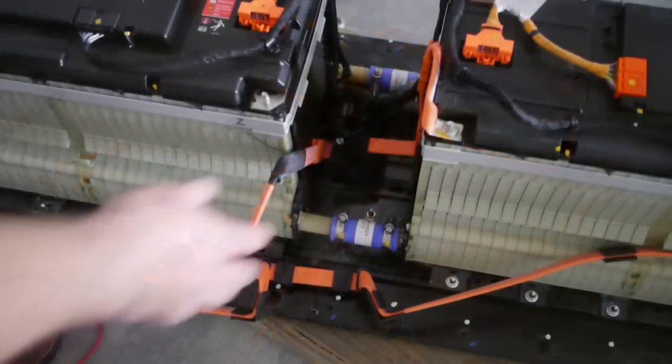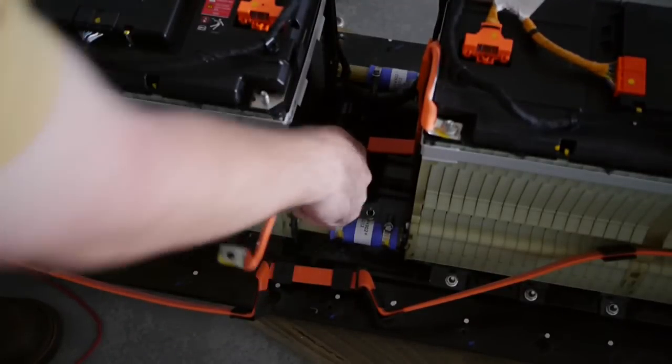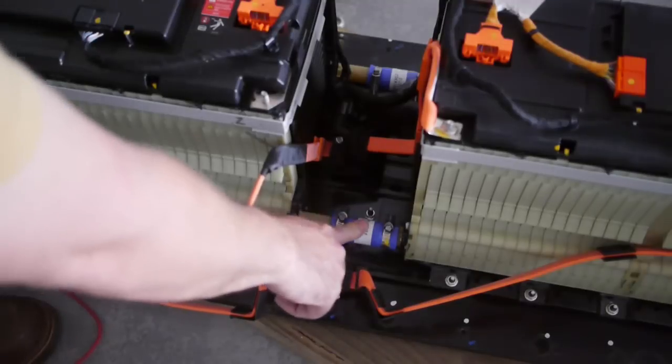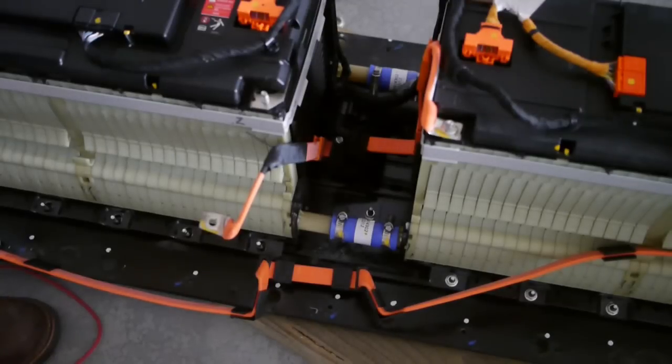One note here — just taking off the battery cables, they pass through this, which I believe is probably a Hall effect current sensor. I'll have to pull that open to see. It gives you a better shot of the coolant lines. Obviously they kept it flexible so that they can assemble and disassemble, and also if there's any movement between the packs, such as in a crash, then it'll be less likely to leak.